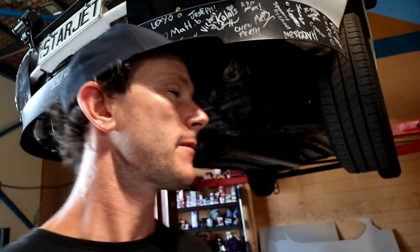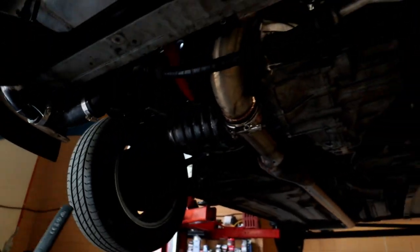Now the current combo that's in this car, we've been driving it around for at least 10,000 Ks and hasn't missed a beat. Since putting it back together, the only thing that we've changed, we've put the oversized piston in there and bored it out. And I'm thinking maybe there's sections lower in the bore that it's a little bit tighter, because when we checked the engine after hearing the ticking noise, I could feel the engine oil dipstick was very hot. So I think there might've been a bit of extra friction there. So somewhere in that second cylinder, the piston's a bit tight on the bore, creating a lot of extra heat.